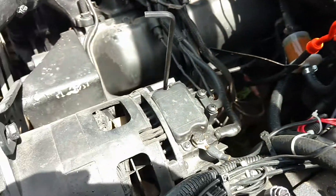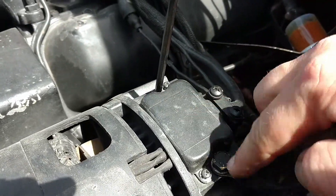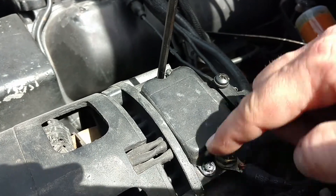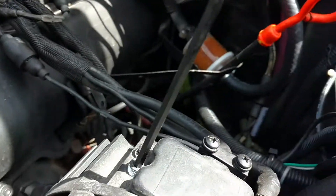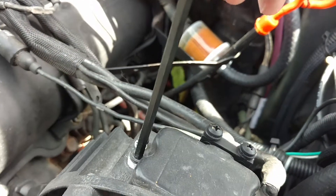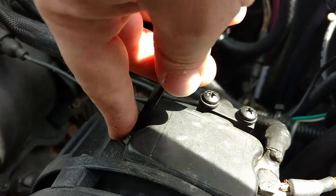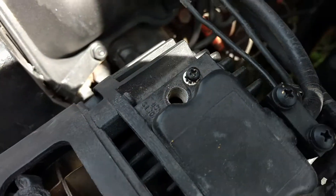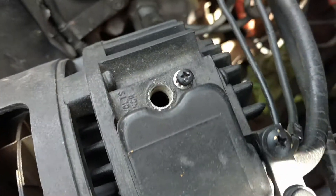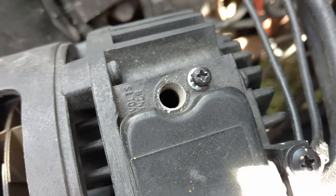Now as we go over to the alternator, I have the Allen wrench there, and other than that this is what yours should look like. You'll first want to remove this cap — be careful not to lose these two screws, they're very small. Once you have the cap off, you'll want to take this plug out with the Allen wrench. This plug covers the adjustment screw used to increase or decrease the voltage from your alternator. There's a small Phillips screw in there used to adjust the voltage either up or down.